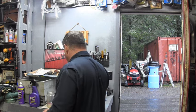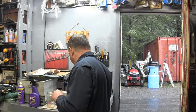Now, I had a couple people say, well, if you put on the solid aluminum bodied carburetor and it runs okay, then why don't you take one of these garbage-raters with the plastic tops and goop that up temporarily with some kind of goop, you know, JB Weld, epoxy, something like that. And I think I will do that. I mean, this is convince you and me step one. I couldn't get the thing to idle with either one of these plastic top garbage-raters.